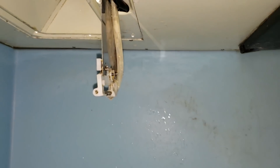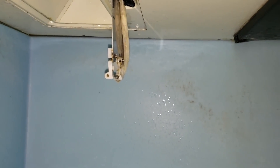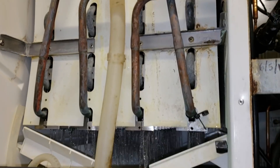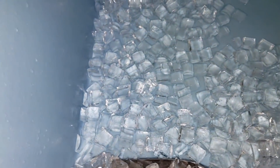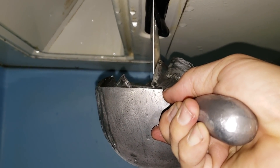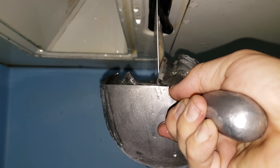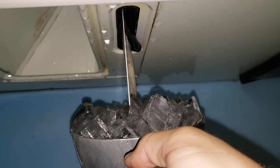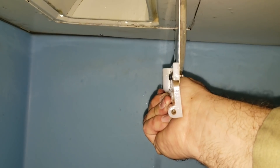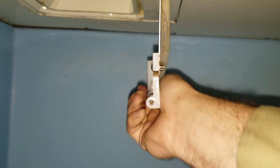To test the bin thermostat, we're going to put the unit into a wash cycle so just the water pump is running. Grab a scoop of ice — just like that. Ignore the first cycle, then watch it from that point forward. We're going to wait for it to shut off and then time it from there. It just shut off right now. You time it with your warm hand — it took three seconds to turn on.